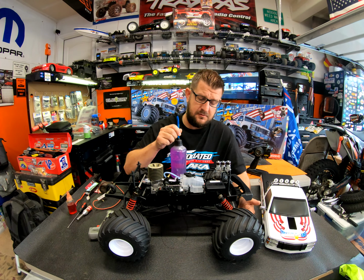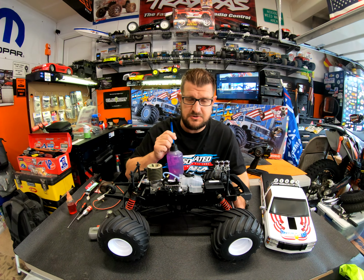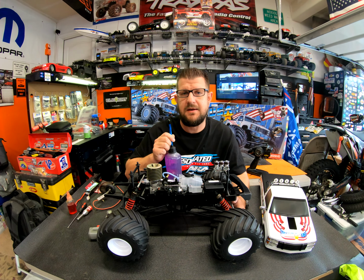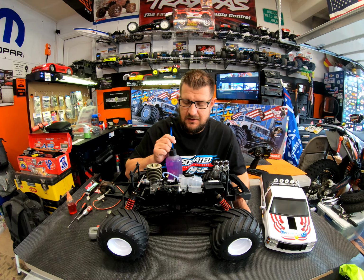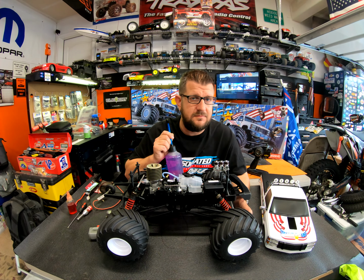A good break-in fuel. I wouldn't go dumping like 30% nitro with 8% oil in this thing right off the bat. In other words, I wouldn't pour any Tessman blends or World blends or whatever in this tank to break the engine in. And that goes for almost any engine. Even my race engines, I always break them in on a higher oil content fuel.